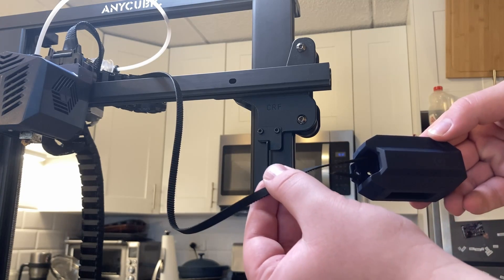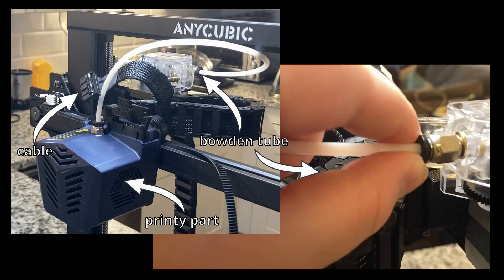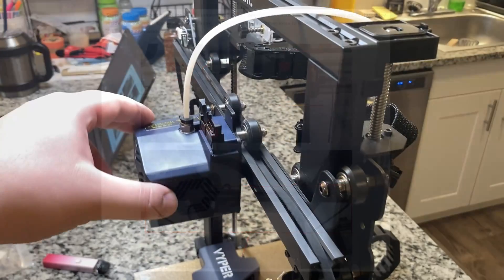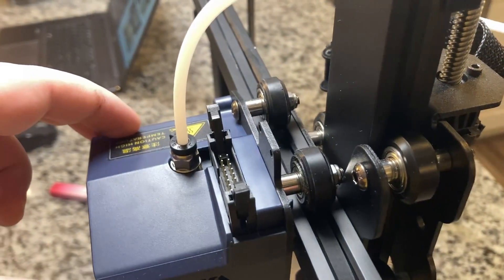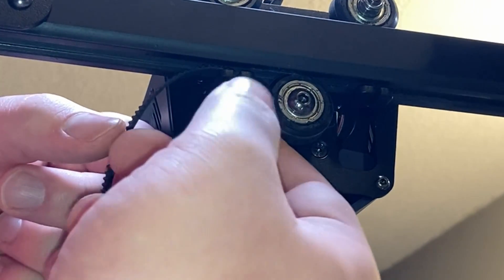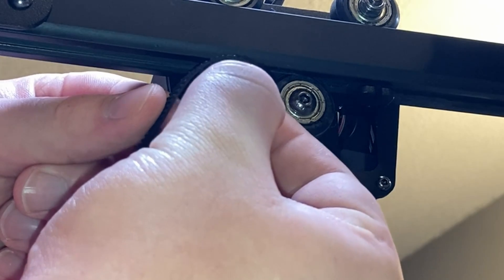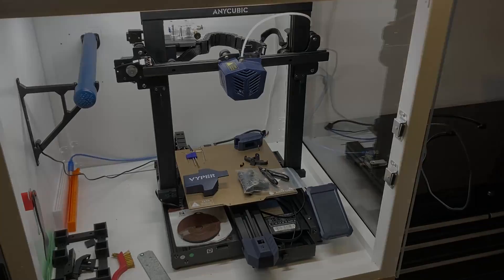Remove the belt from the tensioner and set it aside. I then disconnected the cable and the bowden tube from the printy part, as the guide needed the printy part to slide off the rail. My printy part doesn't fit past this bracket without taking apart more stuff, so I'm going to try to cheese the belt through without removing the whole thing. I then slid off the old belt from where it attaches using the crimps — essentially the belt goes into these slots and the crimps prevent it from pulling out. It was here I realized I needed to order new crimps, so I put everything away for the time being.